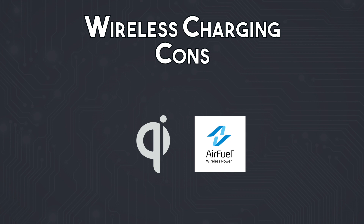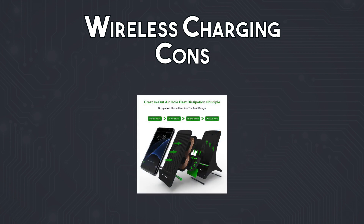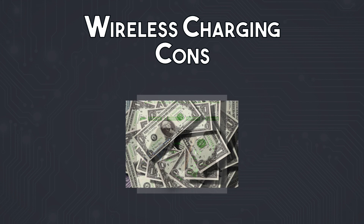There isn't a single wireless charging standard. The two largest currently are Qi wireless charging and AirFuel. Qi will likely be the de facto standard in the future as more devices currently support it, and most devices that do support AirFuel also support Qi, but time will tell. Both the charger and the charging device can get warmer than with wired charging. Finally, until devices come with wireless chargers, the extra investment in cost to switch to wireless charging may not be a price that everyone wants to pay.